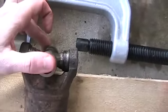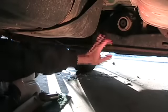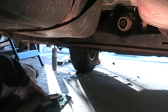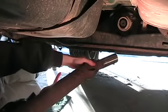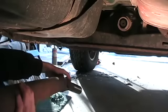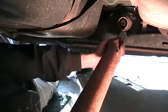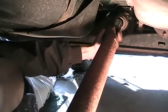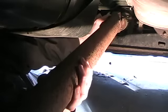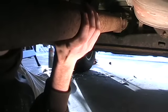We're ready to reinstall the drive shaft. We're back under the truck in winter. This is the output of my driveline — it connects to my transfer case. On the drive shaft I've got my machined surface here, lubricated with some transmission fluid. I've got my u-joint approximately oriented the way it was. So now I get to try not to hit the camera with the drive shaft and reinsert this thing back into the transmission. See how it can slide like that? It's supposed to — there will be travel distance.